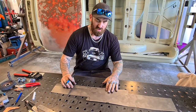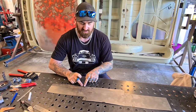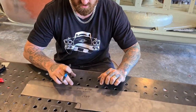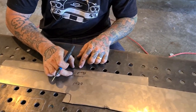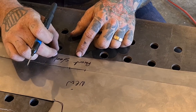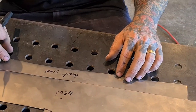Another thing to keep in mind is if you were doing this and you only had a small amount of panel left on the car, just get rid of it and replace that whole panel to this point here. Try and give yourself as evenly spaced as possible between the parent steel and the patch you're putting in. The narrower that area starts getting, the more susceptible to warping it's going to become.